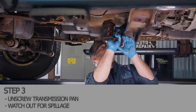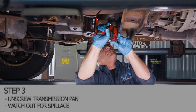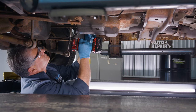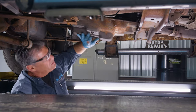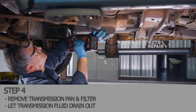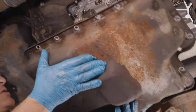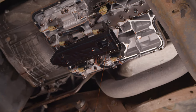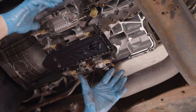Take our 10 millimeter and take the pan bolts out. Come down two bolts and we'll drop her down out of the way. The bolts don't have to come out in any specific pattern — we just go back and forth from side to side so that the pan doesn't get warped. I usually start at the back and come around, then start loosening them up so it tilts down like that.